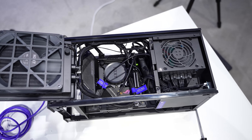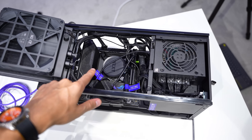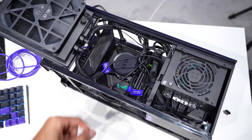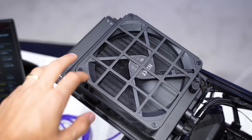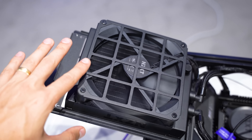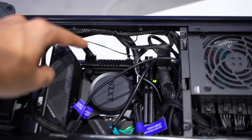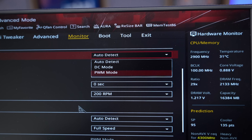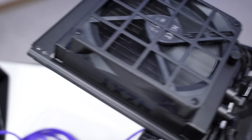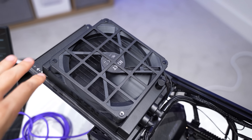Again, I'm really glad that we restarted that system and tested one more time with that Type-C cable disconnected. I've never seen this before, but it works now. We've got everything else reconnected the way it was before. The only thing disconnected is a Type-C cable, and you can see now we've loaded into the BIOS with no problem. This first fan connected to the radiator was completely off though, and I think it had something to do with where it was connected. There's a little hub behind this bracket. So I rerouted that fan to the CPU fan header on top of the motherboard. We're going to lower the RPM a bit — change auto detect to PWM and change standard to silent. That is noticeably quieter. So now the fan won't run at max speed all the time; it'll just ramp up when it needs to.